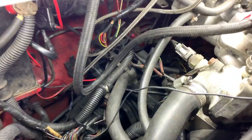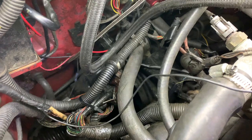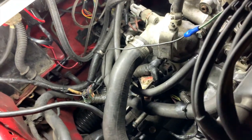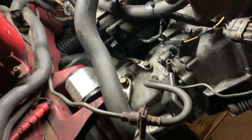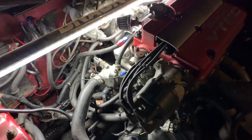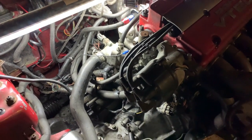All right, so here's where we are. We got the transmission up. It's all mounted on. Just got to do the two 19 millimeters on the back of the T-bracket. Tranny mount is on. T-bracket is pretty much bolted on except for those 19s I just spoke about. And then axles and fluid, and that's about it. Hopefully they built the tranny properly and it goes in the gears and drives off.